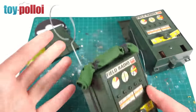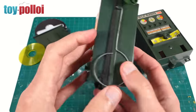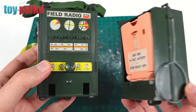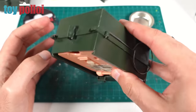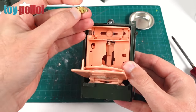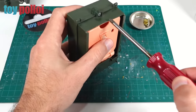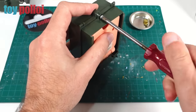We'll start with this one - it's not rattling, but there is certainly some damage to this little connector. I'm going to remove that connector and undo a couple of screws and see what happens. First thing is we'll undo these screws top and bottom on the back and see what this opens up. I can see there are two screws here which will remove this rear panel, and hidden under this little sticker there are more screws which release the inner flesh-colored box.